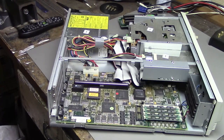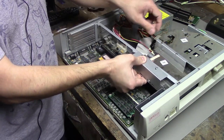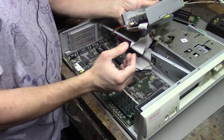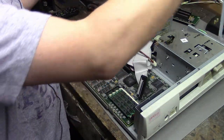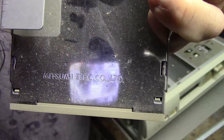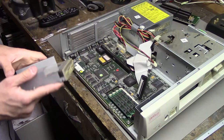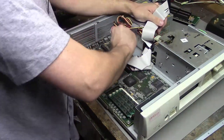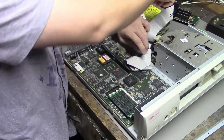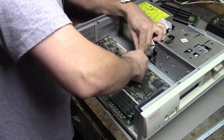I've taken out all the screws on the floppy drive tray so that slides out. It would be easier to get out if I took the cables off — so unplug the floppy cable and look at that, this bar comes out. This is a Mitsumi floppy drive — I wonder if the Mitsumi keyboard is part of the same deal. Obviously OSICOM didn't make the computer; they probably just built it out of off-the-shelf parts. Let's also detach the power supply and floppy and hard drive cables from the motherboard.